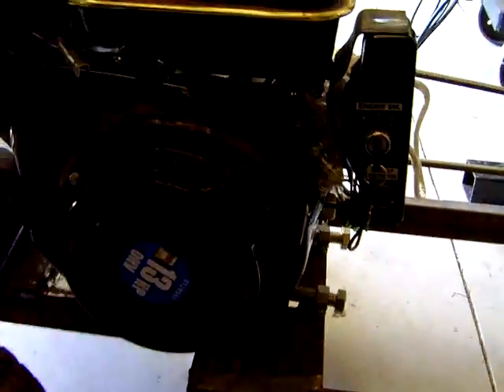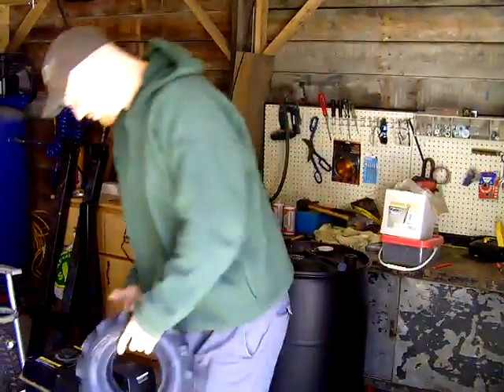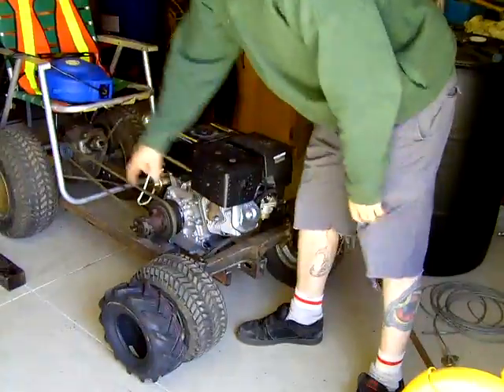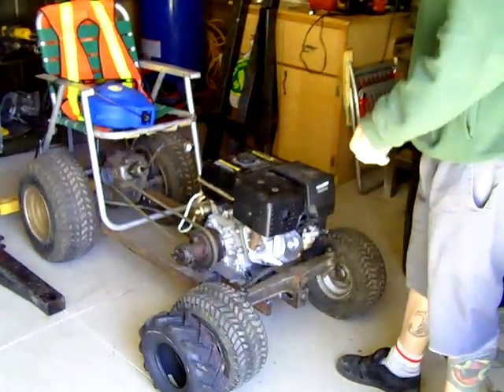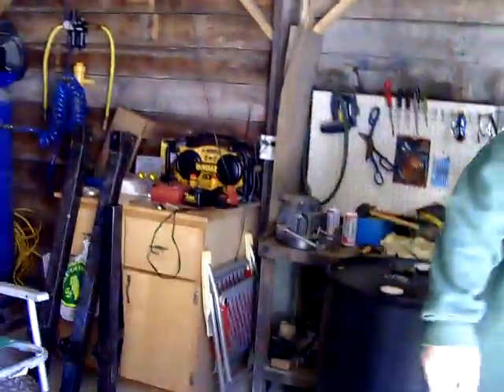There's a dirty old Power Fist motor, 13 horse. We're going to get 20-inch little tractor tires — these ones here are sort of like the front ones, and we're going to get ones that are a little bit wider for the rear. So front tires like that, rear tires the same only 20 inch. Max has got a little tiny pulley, but if that doesn't work we'll try this one. If it's just not quite fast enough, we'll go with what I think was about a one-and-a-quarter inch inner diameter. We just got a new camera so I don't know how to stop it.